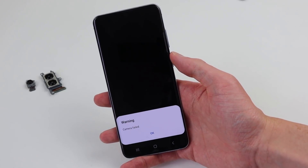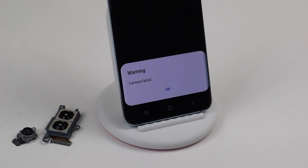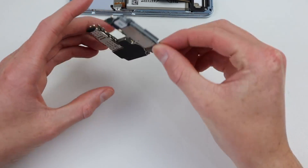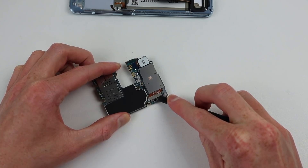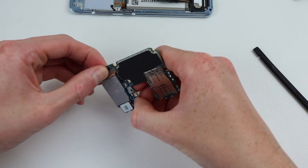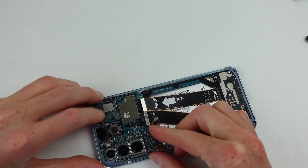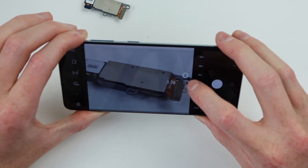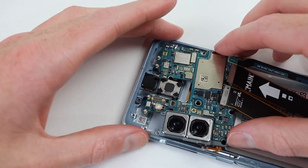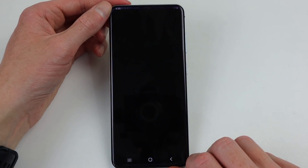So what was causing the camera failed and not charging issues for the guy on Instagram? After some investigating, I managed to reproduce his findings. It appears these issues have nothing to do with Samsung locking down or prohibiting third-party repair, but simply a few repair mistakes made by this technician. I believe his issue was simply that the camera wasn't connected correctly or came unplugged when installing the motherboard. I even caused this issue myself after removing and reinstalling the board a few times, so it's an easy mistake to make. The camera can easily come unplugged when installing the motherboard, so avoid pressing down on the camera when fitting the board into place. After reconnecting the camera correctly, everything works as it should. Removing one camera from the phone and testing again, the issue will reappear, so it's important to have both cameras working in the phone to have a functioning camera app.